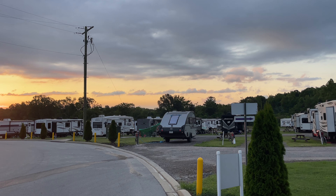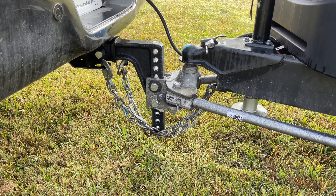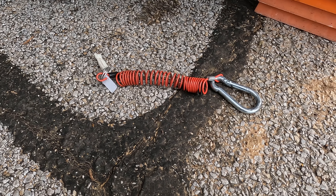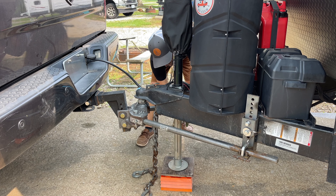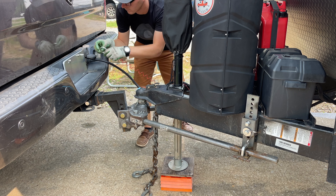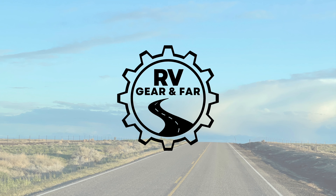Here's a bonus one with hitches. If your towable trailer — fifth wheel or travel trailer — is still using just a static breakaway cable for the emergency brake, you've got to get rid of it. They're a pain, they never go where they should, and people wind them through the safety chains which is absolutely unsafe. Go ahead and pick up a six-foot Fastway breakaway cable. These coiled cables plug into your breakaway switch and make things nice and tidy when you're hooking up your trailer to your tow vehicle. Those static cables for the safety breakaway are just terrible — I'd love to see a coiled cable come on every RV from the factory. Hopefully you found some value in this. Until next time, I'm Joshua — happy trails and happy camping.